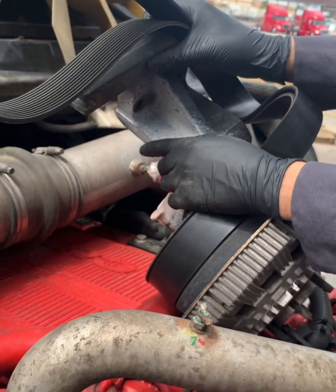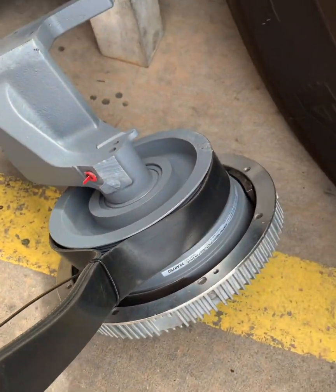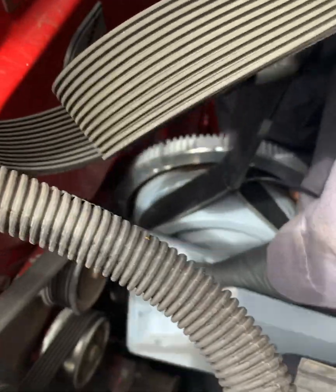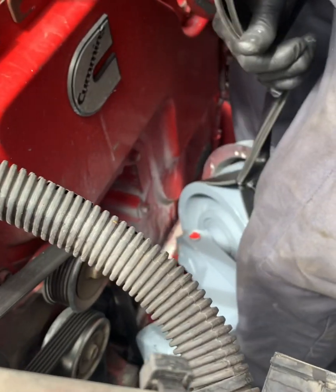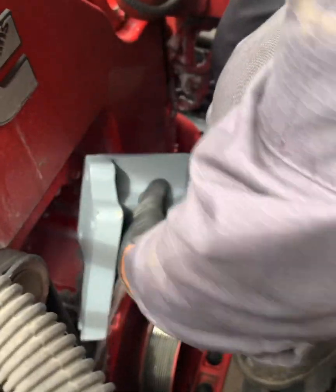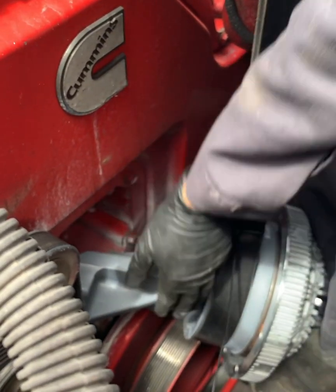You see where that belt comes in handy. Now we're just going to lift up the new one in place and do the same thing — drop it in. Now we've got the belt attached to the new one, we've got the zip tie on there, we've got it around the hub. Now we're going to go ahead and lift it up in front. It's heavy and hard to maneuver, but once you've got that stud on the bottom right there, you can slide the retainer on the bottom bolt and it sits right in place.